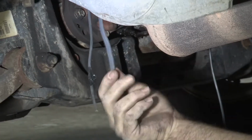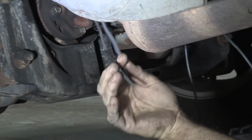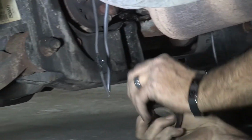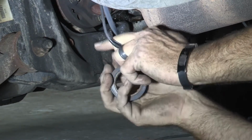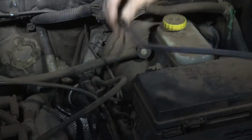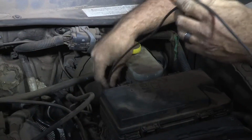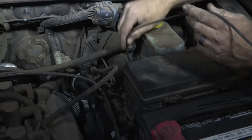Okay, so this is where our pull wire came down right next to our battery wire that we're running. Again, we'll just tape the two ends together, go back up in front and pull straight up. Okay, we're back at the engine compartment. We've got our wire connected. Now we're just pulling up, and there it is. We'll continue pulling until we get all the slack pulled out. There we go, and I'll leave a little bit of slack so I can maneuver around that steering arm.